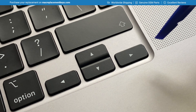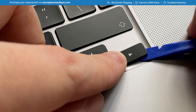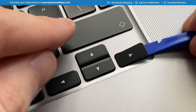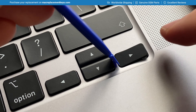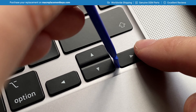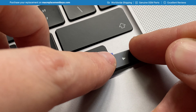To remove the right arrow you can insert your key tool under the bottom corner and keep your finger on the left hand side to make sure the key cap doesn't shoot off. You can then gently raise the arrow key until you hear it click — that is the sound of the key cap detaching from the clip. To completely remove it, insert your tool on the left hand side and gently push the arrow key to the left.